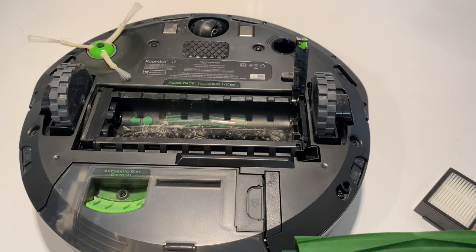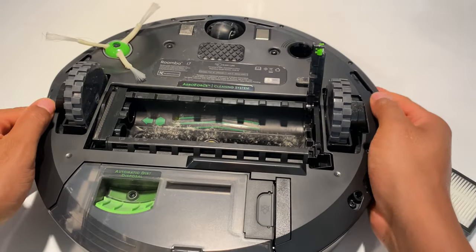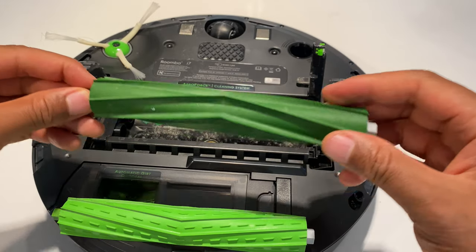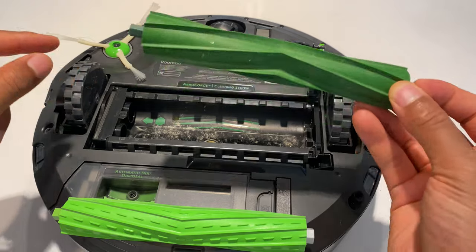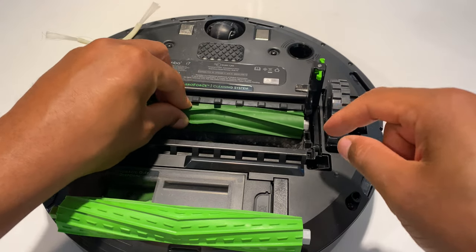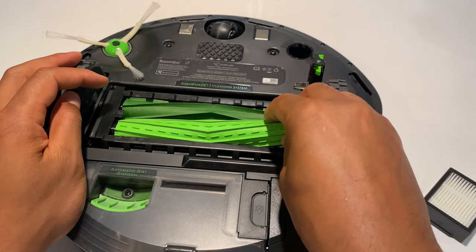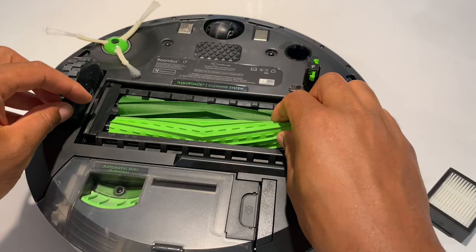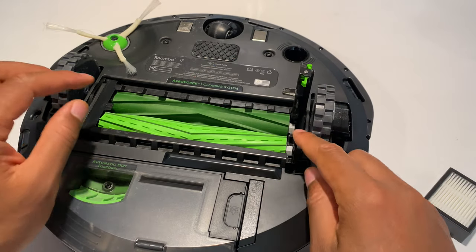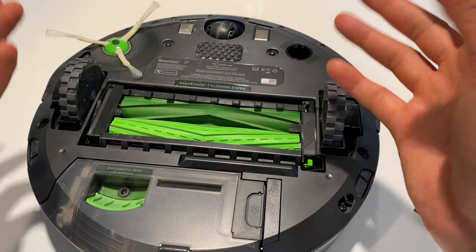When replacing these brushes, if you look down in there it's color-coded — light green and dark green. That's the order you have to put them in. The light green goes closest to you, the dark green goes furthest away. Put the furthest one in first, make sure the light gray tip goes into the slot securely, then put the light green back into place. It can be difficult at times — you may have to spin it to get it to seat properly. Once it's down in the slot, take the lever and push it back into place. The brushes are now clean and back in place.